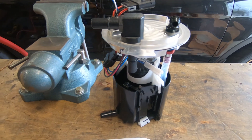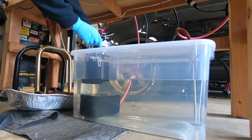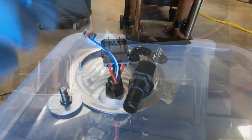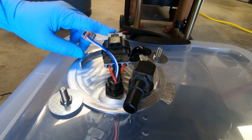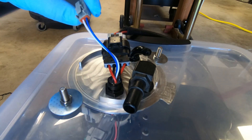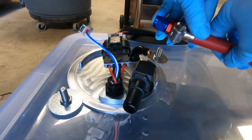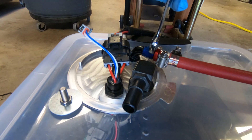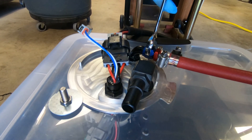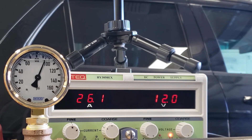Finally, we're going to do the dual pump setup. This is the power for both pumps; we're not going to connect this — this is the power for the connector for the float. Another seco seal here to ensure a positive seal. Note: 12 volts DC does not produce enough pressure to push past 95 psi.